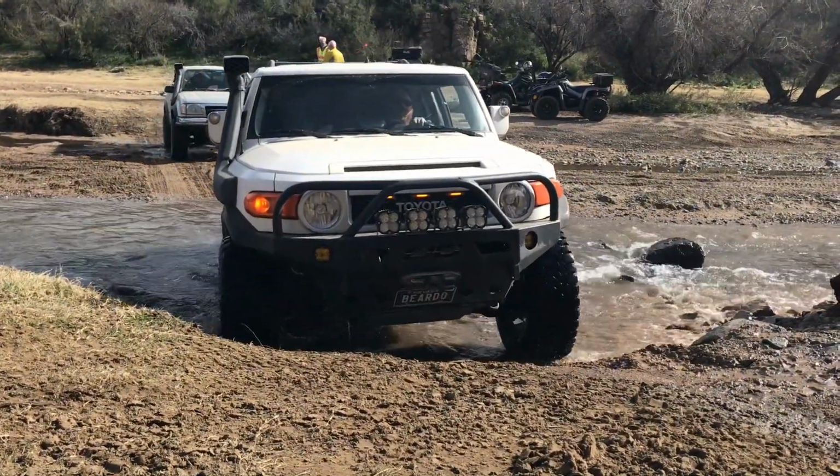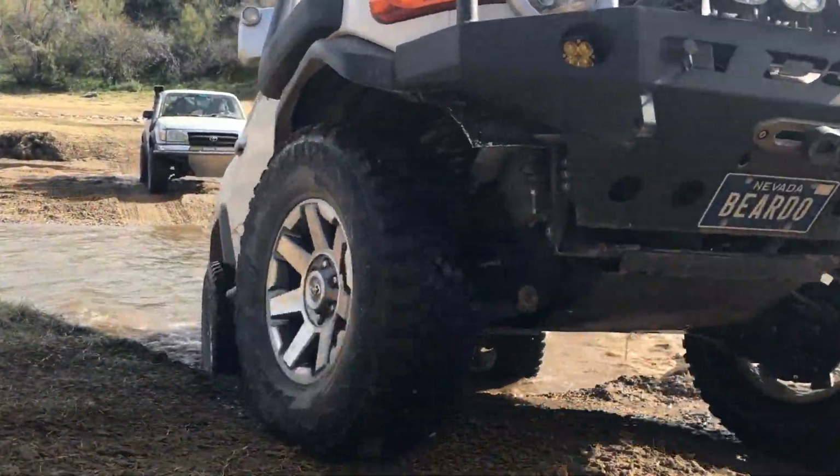The antenna mounts for that, I didn't want to spare any expense, so they actually are Frenched into the roof. They're drilled to the roof. NMO mounts, right? NMO mounts directly to the roof. My theory behind that was I want the best possible range. And I think we've seen that on trails where we're getting massive amounts of range and blowing people away by just how clear and crisp those comms are.